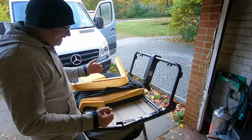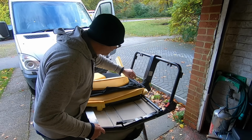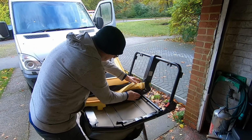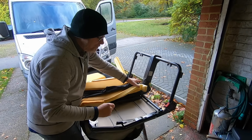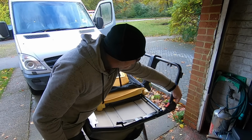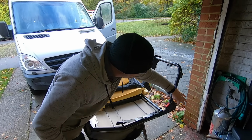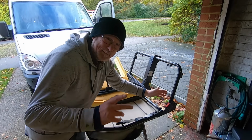And yeah, it looks like it's going to be really simple to do. There's a main bar here. This bar goes right across the seat, so I'm simply going to cut that off there, this side of the seat belt channel. So that's going to cut off there, really simple. And down here, this seatbelt mount will go, but there is a mounting point there which mounts this base to the base unit of the seat. So I'm going to leave that a bit attached, but cut the bar there. I think that makes sense.